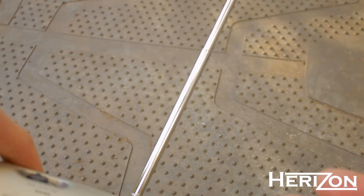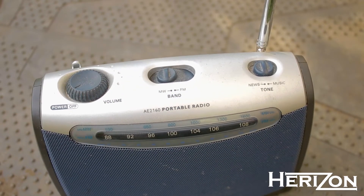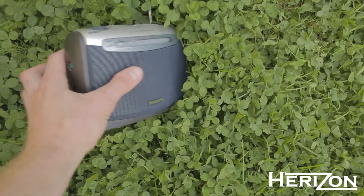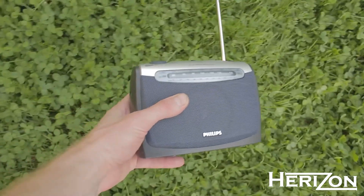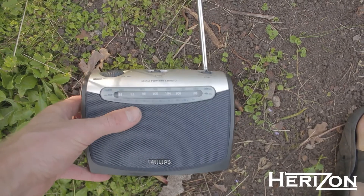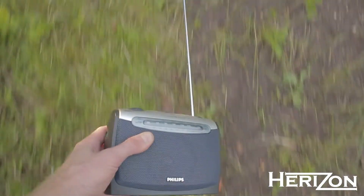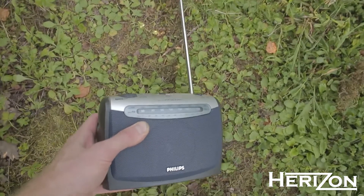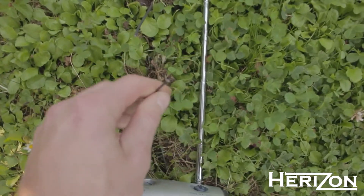If the signal fades where the boundary wire turns towards an island, this indicates that the break is on an island or inside the parallel cables which lead to an island. When you go along the troublesome cable, at first the signal is pretty strong. Once you come near the cable break, the signal starts to fade out, so you have to adjust the volume all the way up. At this point you can still listen to the signal, but here you can't — and there is the cable break.